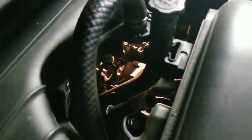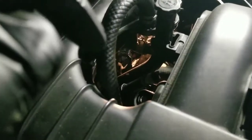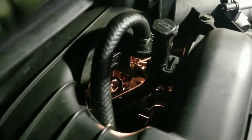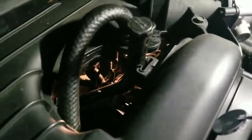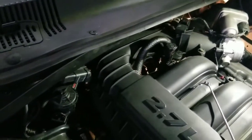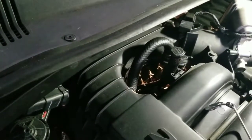there's the metal bracket that sits on two bolts over there, and it holds the wiring. So first you gotta remove that thing, and then there will be bolts. So the metal bracket is attached to 2 bolts. Yes, you remove the nuts, then you remove the metal bracket, and then you remove the other 2 bolts on the transmission, so pretty much 2 more bolts. Yeah, 2 more bolts, bro.